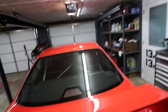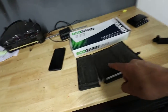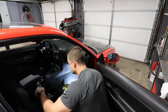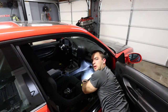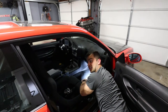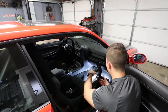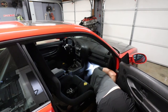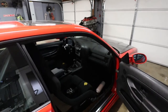All right boys, dash is fully installed. Before I get too far, let's throw a new cabin air filter in because this one is disgusting. I venture to say I'm gonna get a lot more fan speed because it wasn't very powerful - important since it doesn't currently have AC. Definitely need to vacuum that out - that's gross. That's done; I'll check fan speed in a minute.